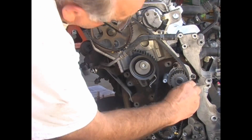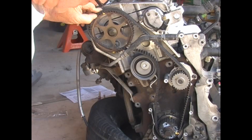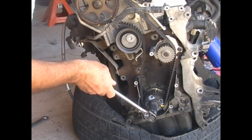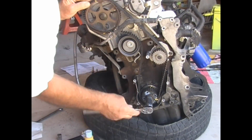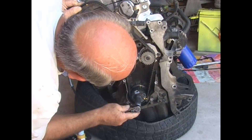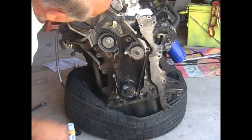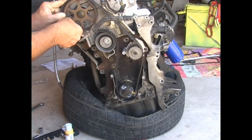Just like before, you can't quite stretch the belt, so you back off the crankshaft a little bit and get the belt set. Then go forward and see that the belt is now tensioned on the right side. If you turn it any more, it would start turning the camshaft. I'm actually having a little trouble with the belt slipping, so I'm having to redo this a couple of times. This is why it pays to have the mark on the belt.